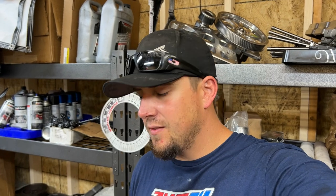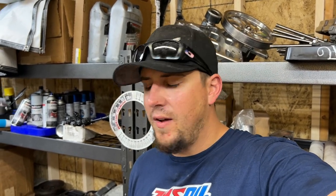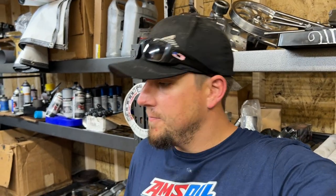This one came to us at like 5, 5.5, which is fine at factory power level. But being a somewhat stock bottom end 5.9 and the customer wanting to drive a big single on it, we did open it up. I believe this one's sitting at right at 7,000ths piston to wall. For bearings, we're gonna try and shoot for right around 2.5, 3,000ths on the rods. The crank right around 3.5, 4,000ths on the mains. And yeah, that's where we're setting this one up at.